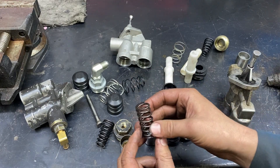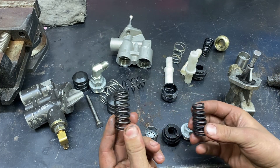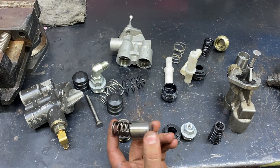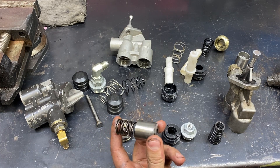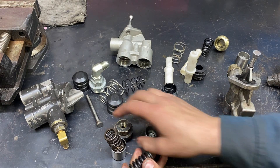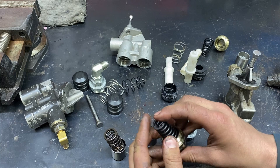The next thing is the spring inside. This is the original spring — a beehive-looking thing. This is a CompCams 973-1 spring, basically a valve spring for some application that somebody figured was the right size with a heavier spring rate. Just put that in the plunger to replace the original. On all stock fittings with just this spring upgraded, it'll support about 700 horsepower — possibly more if you spin more RPM. Really just watch your fuel pressure during a run to make sure it's not falling. I've also found a washer that fits inside to space out the spring, which helps the spring rate a bit — a good alternative for cheap guys digging around the garage.